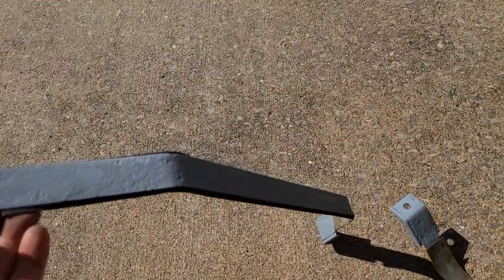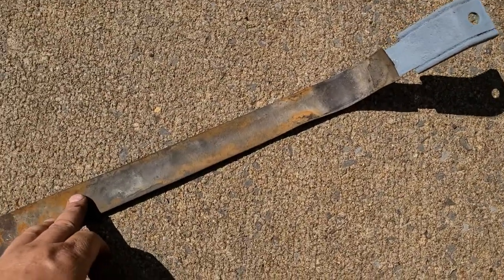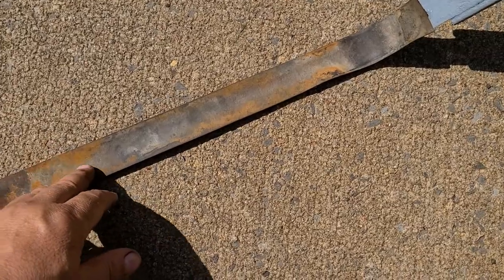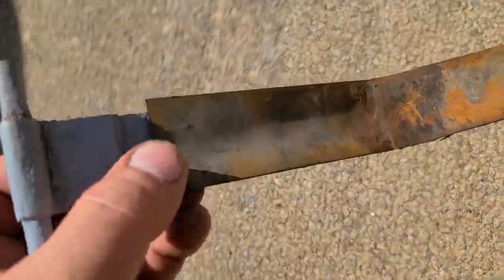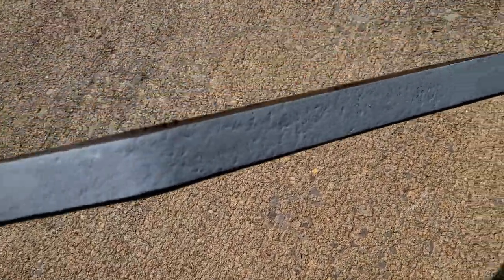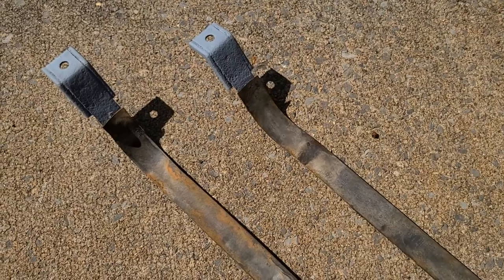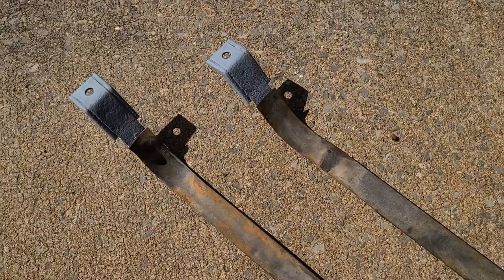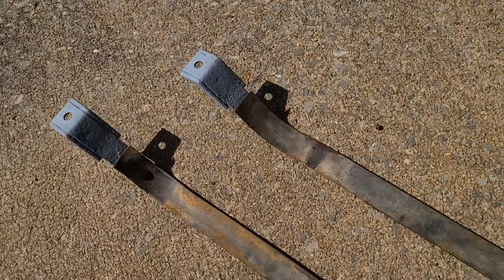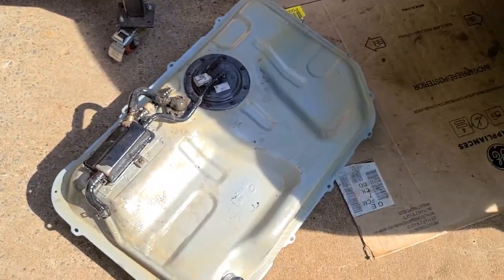I ordered new straps but the other ones were the wrong ones, so I didn't have time to order others - I just sanded these all down. There's a little rubber strip that goes on here originally, but it fell off - it had water under it and corroded. So right here I put a little clear silicone on it so it won't fall off when I install them. I went ahead and sanded them all down and put a self-etching primer on there. The reason I didn't paint them is they're going to get fluid filmed - this primer just takes the blunt of the bare metal off, and that fluid film is going to be better than actual paint.